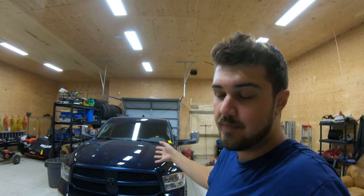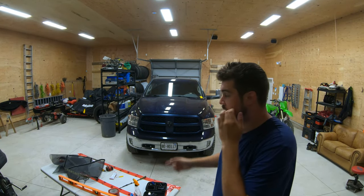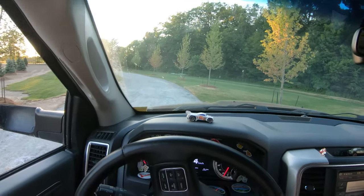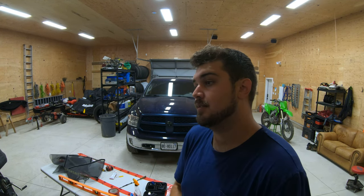I recently replaced the battery on this truck — the old one kept failing whenever I'd run the radio for about 10 minutes. I kept the old battery because I want to put it in the back of the truck and run a battery isolator. It's a module that basically charges the rear battery once the front one is up to a safe voltage, and that allows you to still start your truck. So when I drive during the week, the back battery gets charged, and then when camping on the weekend I have 12-volt power without worrying about killing my main truck battery — because that sucks, especially when you're in the middle of nowhere.